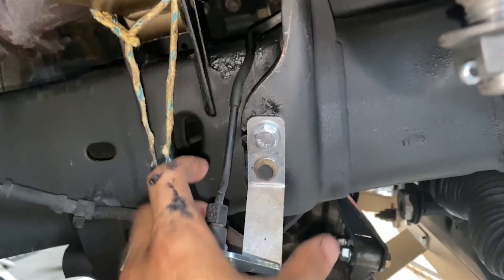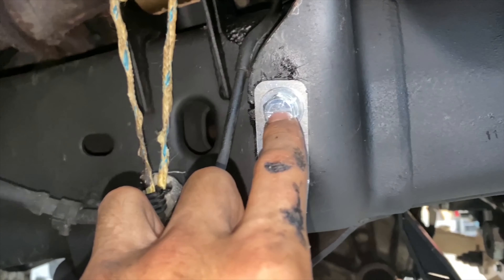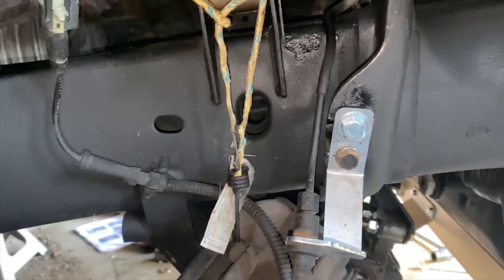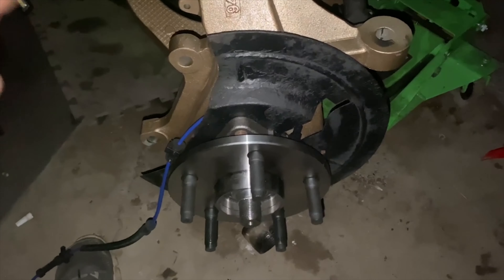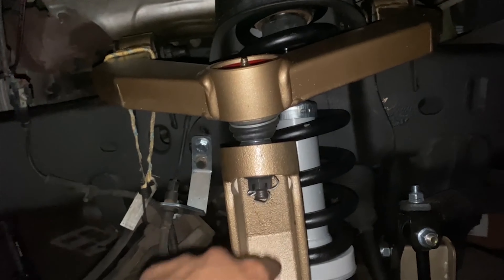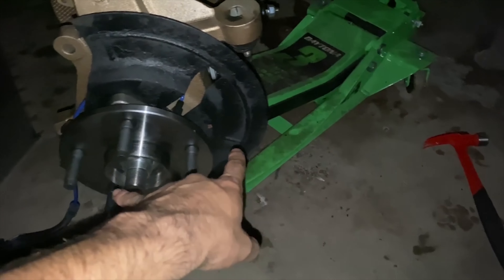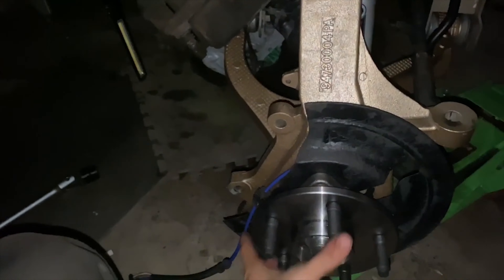This is how it should look — this one came out a little quirky, should be a little straighter, but it's alright. You use the three-quarter inch long bolt at the bottom, insert the brake line here, use the stock bolt at the bottom since it's already threaded, and use the provided one-inch bolt on top. You have to bend the brake line a little so it adjusts to the new spot, but everything should work. I spray paint every exposed metal section.